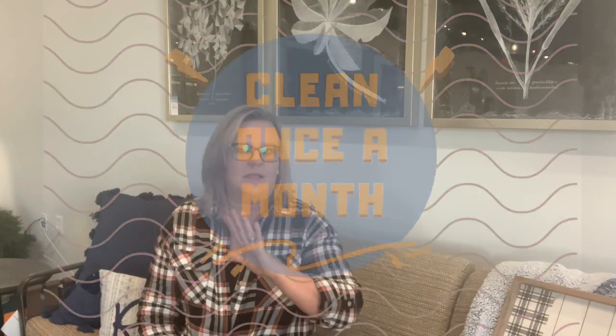Our number two service call — and this is an everyday thing — every day in the winter months we get a phone call about lights flickering, the hot tub being cold, or something along those lines. The number two reason we're going out is people's filters are dirty. You have to clean your filter a minimum of once a month. If you've got the tri-x filters, it's fantastic to throw them in the dishwasher — you can only do that with the Hot Springs tri-x. If you have the paper filters, you need to use the degreaser.